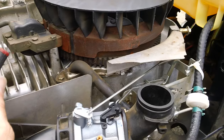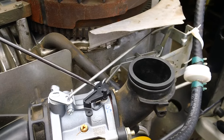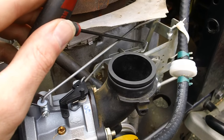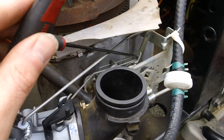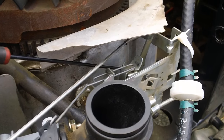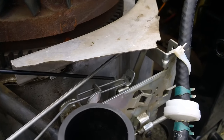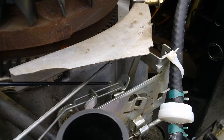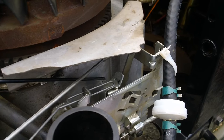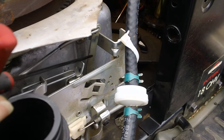Let me get this camera situated here. Okay guys, see right here — with your actual linkage here for your choke mechanism. Your choke mechanism goes down to another plate right here. You see this plate right here specifically? Well, this plate also has a little small triangle-shaped tang right here. You can see that? Let me zoom in, sorry about that, get a better picture for you guys. You have a little triangle-shaped tang area and there's a spring hooked onto it with a little black arm pulling right here. That goes down to your governor, where it comes out of the engine.